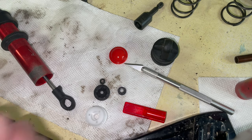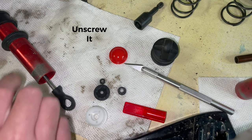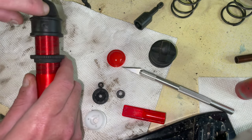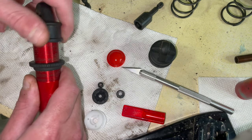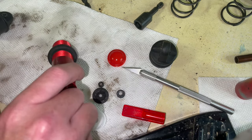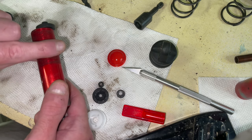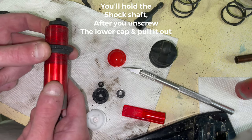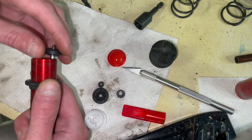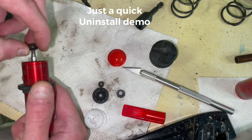The best way for me to take that off was needle nose pliers — I just stuck the two ends in, for the R-to-R version that is, and pinched it and pulled it off. Then I take my head off with a hex driver. I stick the hex driver in here to just loosen it and tighten it. Then I push it all the way up once I get all my shock oil out. I get a 7mm nut driver, hold this right here with a wrench, take my nut driver, take that nut off, and save the nut.